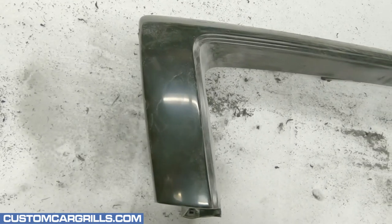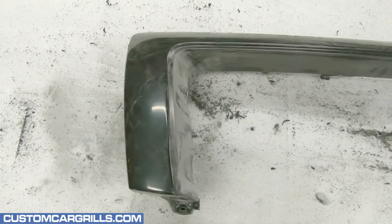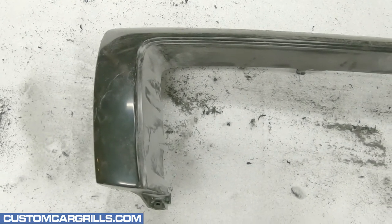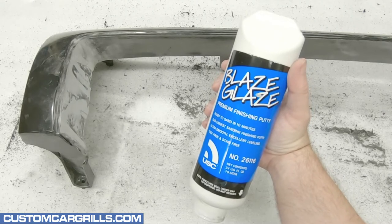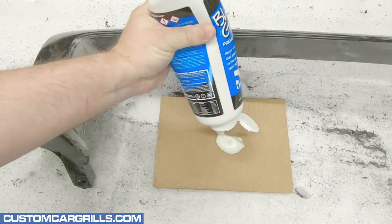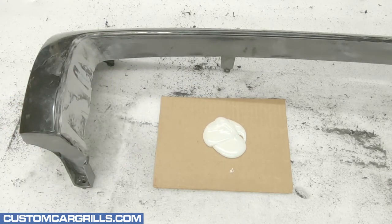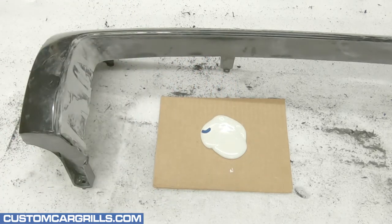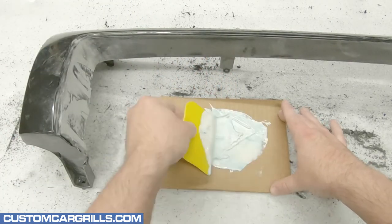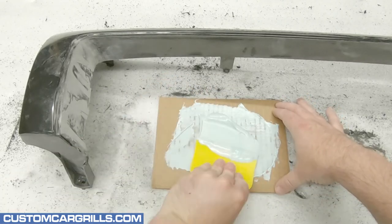At this point, I just don't want to have the edges protruding out — having them smooth or slightly inward is good. Next up is the finishing putty and for this I like using Blaze Glaze. Generally, I didn't need to dispense a lot of the putty but I'd rather have too much than too little. Then I'll add a pinch of hardener and it's ready to be mixed up. Just a basic squeegee is a good tool to have for mixing the hardener in.